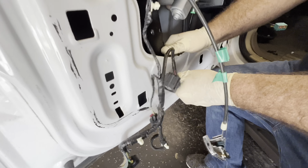There are a couple of screws to get at on each one — one right there and one on the other side, and they're 10 mil each. There's an access spot right there. Let's take these pins out so we can lower the window and manipulate it. Now we've got the window up in place — Brian's reaching through the provision to tighten the window regulator guide against the bottom of the window — nice and firm, just make sure it's snug.